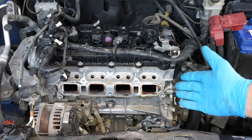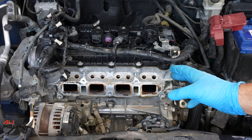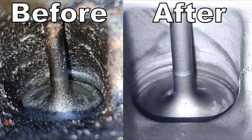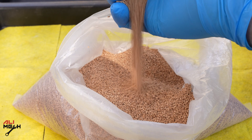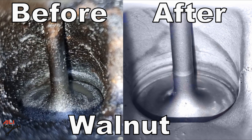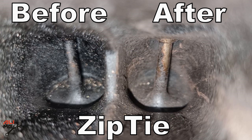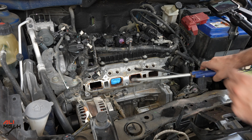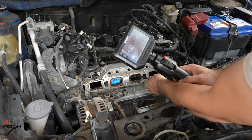Bottom line: it looks easy but the results are inconsistent and the risk is way bigger than the benefits. If you want an effective way to clean intake valves properly, the sandblasting gun is the perfect way — it will give you the best result, like new. With the sandblasting gun you use walnut shell media; even if walnut shell gets inside the engine it will burn and come out, and it's very gentle on the surface — it won't scratch the valve or valve seat. Here are the intake valves before using the sandblaster gun with walnut shell — you will not get a result like this with any cleaner. Hope you found the video useful. Like and subscribe if you haven't already, and I'll see you in the next one.